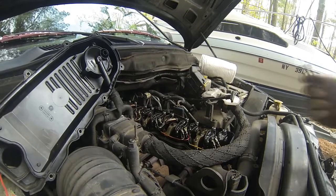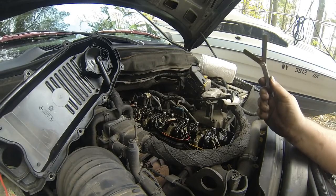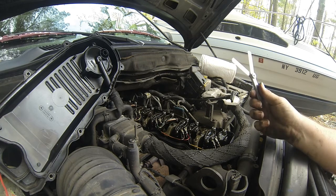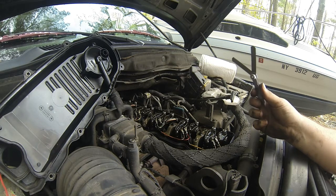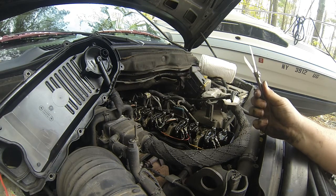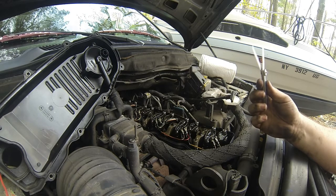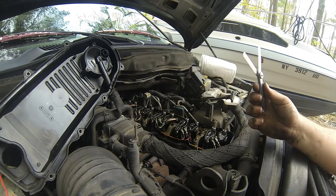The two sizes you're going to need here are a 010 and a 026. Unfortunately, the feeler gauge I purchased comes with a 022 and a 011. I don't believe the 1 thousandth of an inch difference on the intake and the 4 thousandths of an inch on the exhaust are really going to affect that much — they're basically a 0.01 and a 0.02.